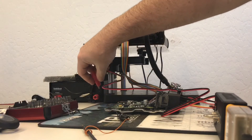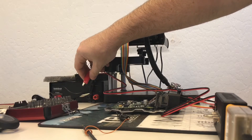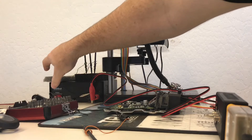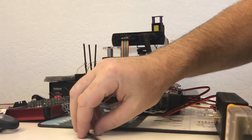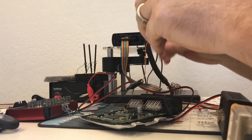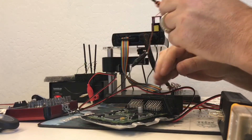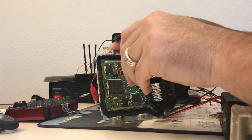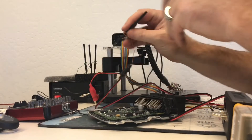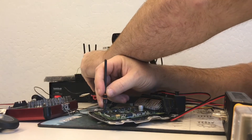We're going to leave the positive off because we want to use this to turn the power on manually — we don't want to use the switch as it could put too much voltage in there. We have everything connected. We want to turn the power on, locate our boot pin as per the diagram. On this ECU it is just to the opposite end of where it says Infineon. Go ahead and put the boot pin on it, hold it, and connect our power and leave that there.